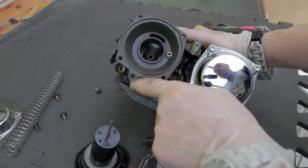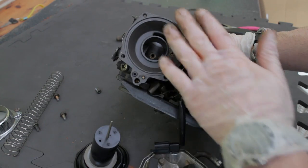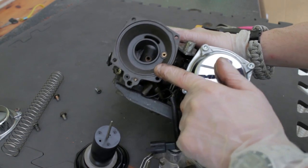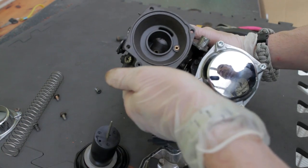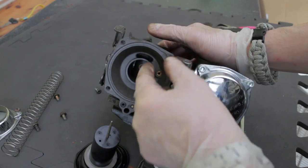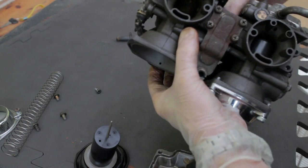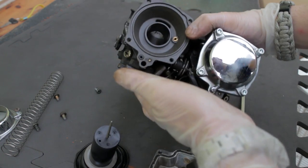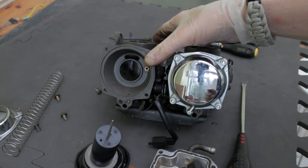As you're blasting airways through with compressed air from your compressor, these things can ping off and fly into goodness knows where — and sometimes you don't even know you've lost them until you put everything back together and nothing runs right. So have a very good visual check around before doing any blowing with compressed air. Check all your little nooks, crannies, and airways, because there will be lots of them. Then give everything a good wipe through and make sure there are no obvious scratches or marks.